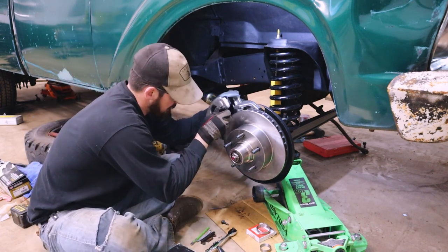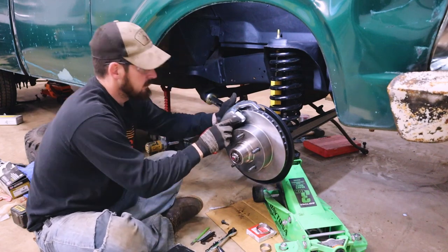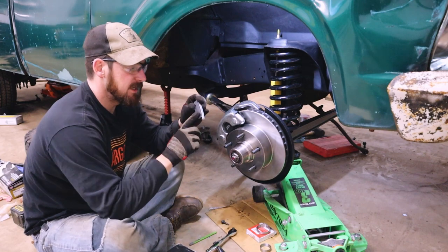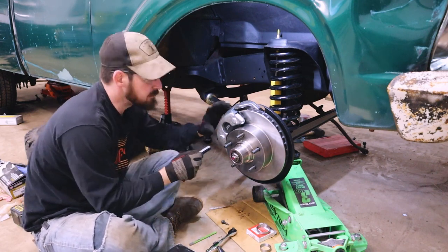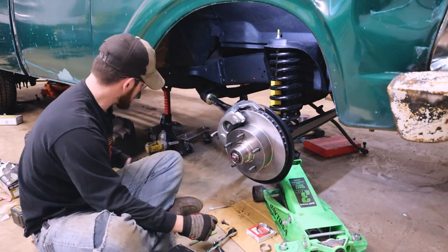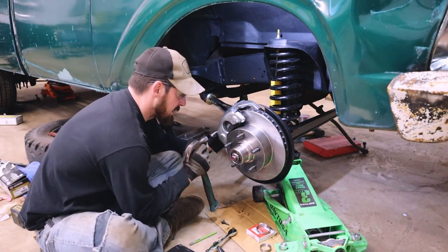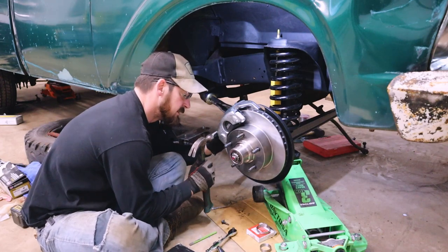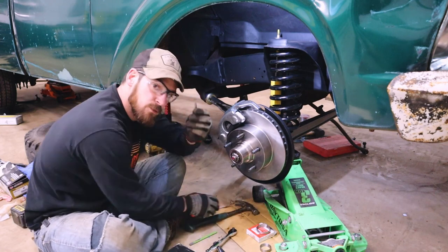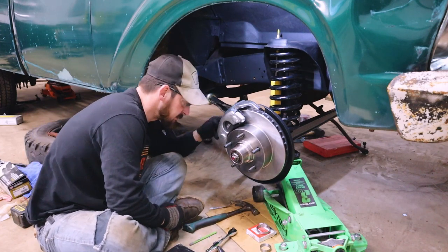The F-100 calipers are a little different than your typical newer-style brake calipers. They lock onto their bracket with a retaining clip and a spring — this spring is driven in from the front on the bottom. You push the caliper up, get the spring started, and after you get it started take a hammer and drive it in. You don't have to beat it; it goes in fairly easily, just tap it in. Get it in about center, then there's a retaining bolt — a lot of people lose these, but the new caliper came with a new bolt. Put that in place and tighten it down.